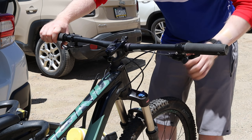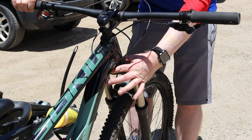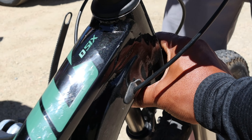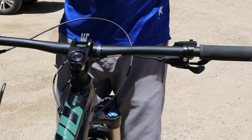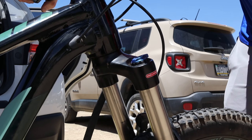You can adjust the brakes independently of the handlebar. My handlebar is crooked though — we'll fix that. So this is different. It just clicks when you are at the correct torque setting. That is how you prevent from stripping out your bolts. This is the torque wrench all you guys were talking about — here it is in the flesh. It's one of the many torque wrench options on the market. I had already kind of finger-tightened it using my multi-tool, and the quickest way to make sure it's tight enough is to just grab the front brake.